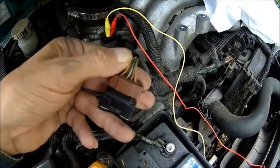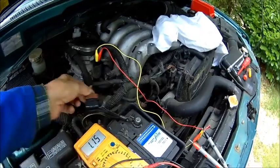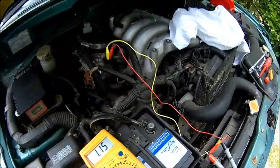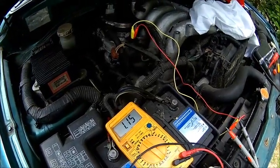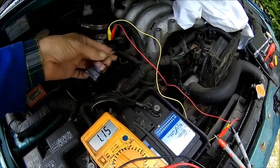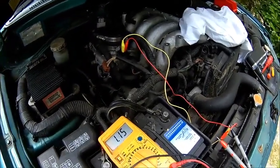You can see the wire is pinched - so someone was measuring here. Maybe they had the problem before. Because you never know - it could be somewhere in the loom. All I can say is the sensor is fine. What's left is the loom itself and the connector, or the other side on the ECU - poor connection over there.